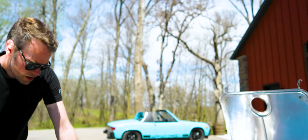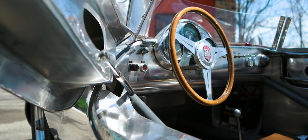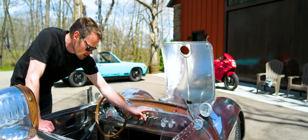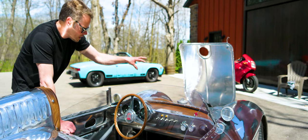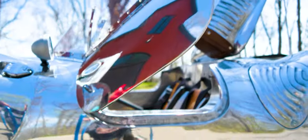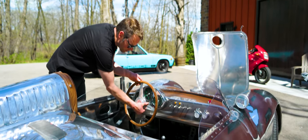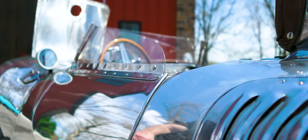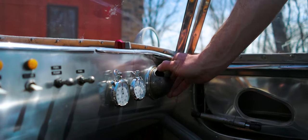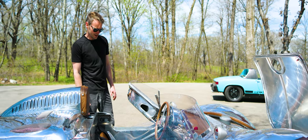The cockpit features Porsche 912 gauges and aviation-style switchgear. Signals have their own indicator lights so you know when those are off and on. Your headlights are here, and there's an electric fuel pump. There's also a distribution switch to divert fuel from the main tank to what we call a qualifier tank that's hidden under here and has its own separate filler point on the side of the car. It's got a removable steering wheel so it makes it easy getting in and out. The doors have a swing-forward type of movement — you can see the aviation-style strut to hold the door open. There are rally clocks and a period ashtray. Overall, a very simple, utilitarian, and to-the-point design for the interior.